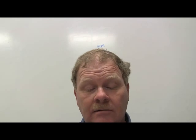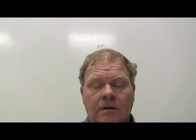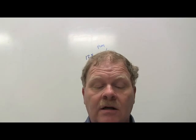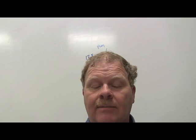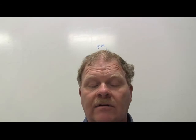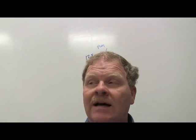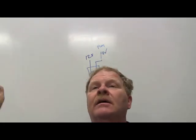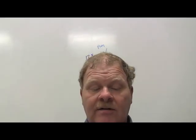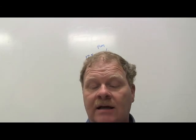All right, let me see here. What number are we on? I forgot. 35. A conventional oxygen sensor heater keeps the sensor at about 600 degrees. 36. One advantage of a planar type oxygen sensor is faster light off time. When the air-fuel ratio is expressed as lambda, a lambda number of less than 1. Now pay attention, guys. Your scan tools, a lot of them are going to be reading lambda instead of the other stuff. So what do you think? 37, that's going to be C, basically. Less than 1 is a rich exhaust on one that's reading lambda. Okay, well, what's a lambda?